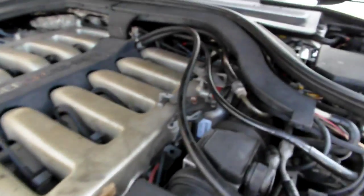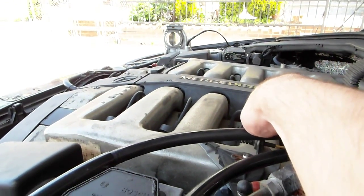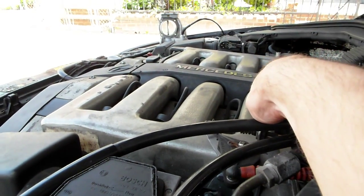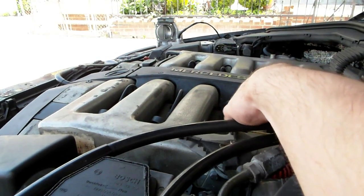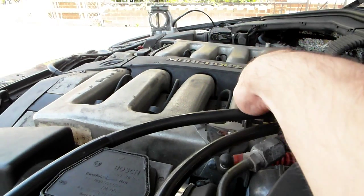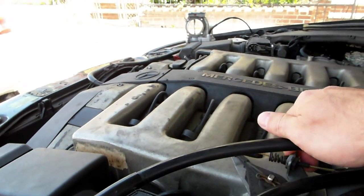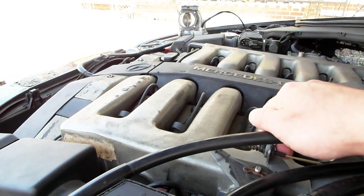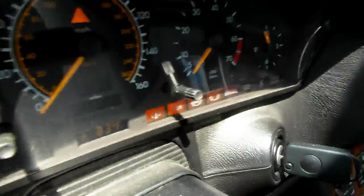It's nice and healthy — that's my unit. So I'm going to activate the throttle and you're going to see that unit open. It opens fully, everything is fine with it. Moving the linkage on the primary and secondary opens correctly. I can also start the car to show you there is no ASR light or anything like that. It won't run correctly because the slave unit isn't letting air in, but at least you can see yours is not setting any ASR lights or limp mode. It opens and closes, no problem.